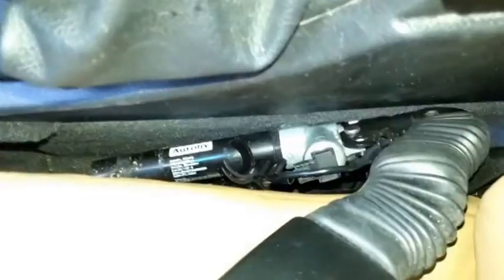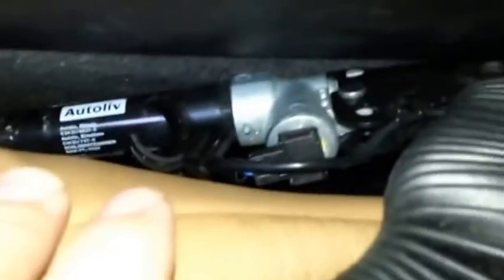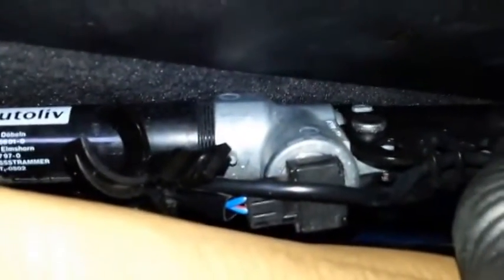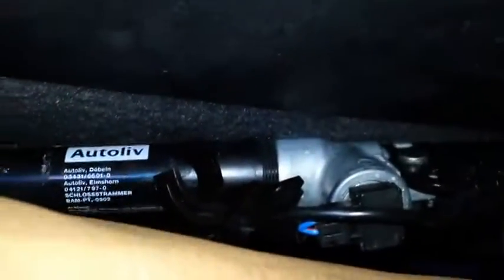It's coming out and there are two cables on the top. Now there are these two cables that I need to remove. One of them disconnects right here and the other one disconnects under the seat. Taking off the bolt was the easy part — this is the hard part, not much room. There's this little bracket here; I already pulled mine off. You have to pull two of them off so you can free this.